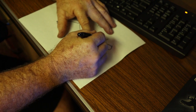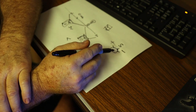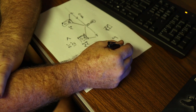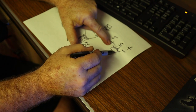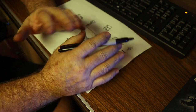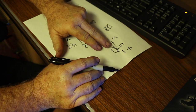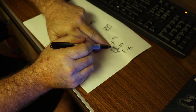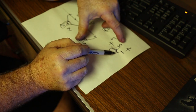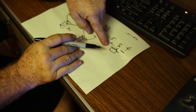A three-wire sensor is going to get power, ground, and it's going to have a signal. It's basically a variable resistance. They'll put, say, five volts in on the power side, and then you'll have a ground. The sensor is going to vary based on temperature, position — whether it's a throttle position sensor that varies resistance, or a temperature sensor using thermistors. All you really need to know starting out is: five volts goes into a three-wire sensor, it has a good ground, and the signal coming out should be reliable — what the computer expects to see, from 0.01 to five volts.